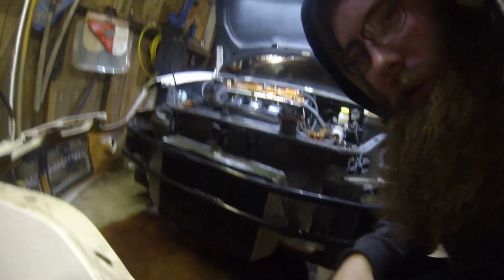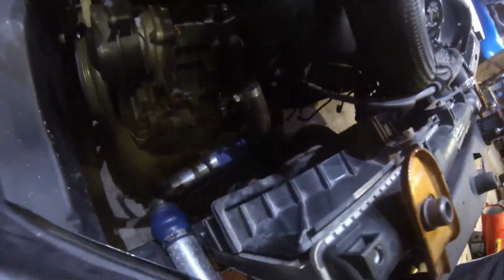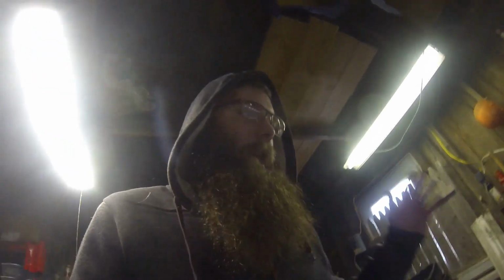So with this car, we ended up doing the CX Racing, like I said, Evo style intercooler. And what I did was I cut the tubes off on both sides. We welded pipes in so everything works with factory style piping. That way I could buy a pre-manufactured intercooler pipe, and I didn't have to deal with trying to run it through the core support anytime I had to service the car, if I had to pull a transmission to do anything with it.